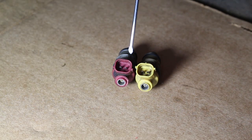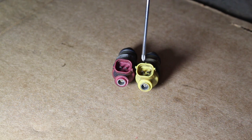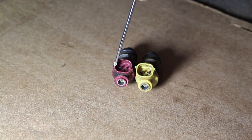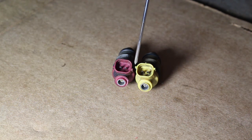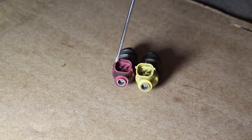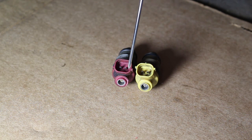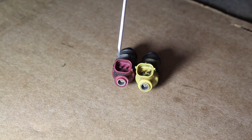This is the 1JZ injector, and as you can see the tabs on the side are closer to the top, and there's a tab up here on both of them in the same position, which is the important one for securing the clip. But on the 3SGTE injector, the clips are lower, so when you try to put the clip on, the slots are up here but the tabs are down there, so it doesn't clip on. What we did was just take a Dremel and grind these tabs off. A lot of people might be afraid of doing this, but the clip clipped right on. We still kept the top clip, which holds it on, and these just kind of align it. It works perfectly.